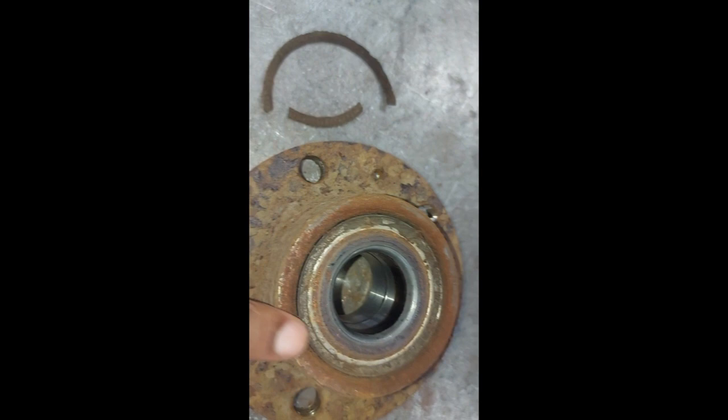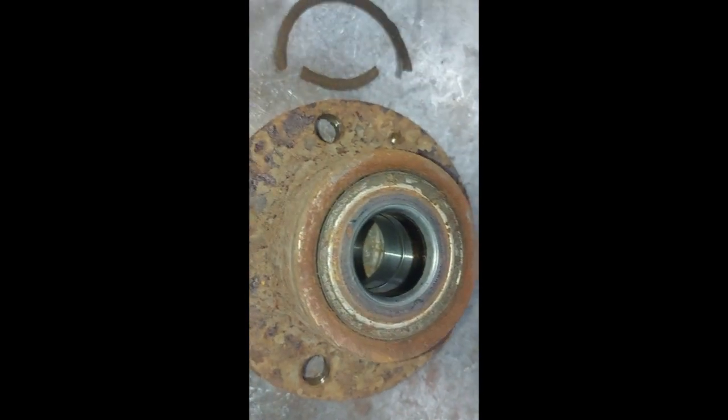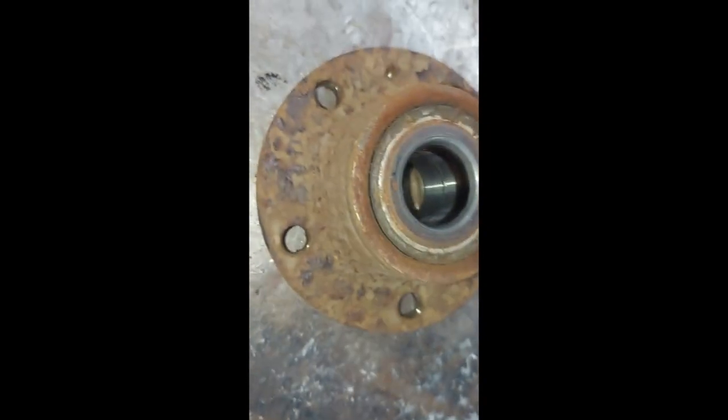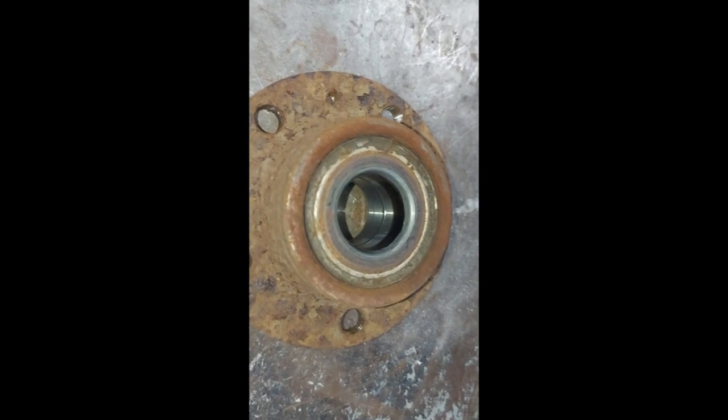This is a different type of ABS sensor. Others read on a metal reluctor, but these ones are actually reading on this. See, on these ones here, you see these lines, one is north, south, north, south, north, south, north, south. So that was the issue that gave us the 00287 fault code.